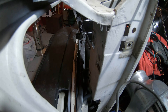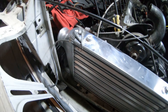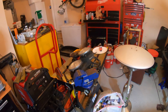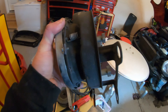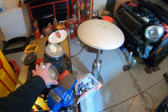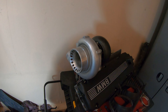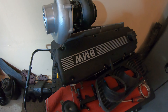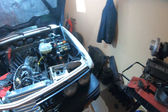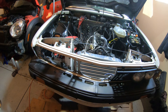The plan is to cut down through here where the headlight kind of mounts — slice that off, same on that side. Maybe relocate the horns permanently if I have to; I'll see if they'll fit back on after. Also going to shave down the back side of this headlight housing, cut these brackets off. Kind of just wing it as we go and do what we gotta do to get this thing in, then make new brackets. I recently rebuilt the turbo while I had it out, polished that up, crinkle-painted the valve cover, cleaned that up too — just waiting on that head gasket. I'm going to try and get some footage while going at this, some before and after of the cuts. Stay tuned.